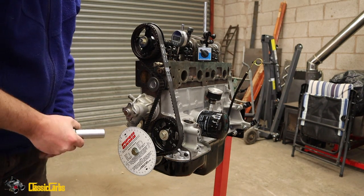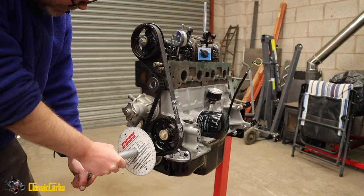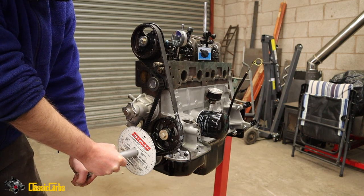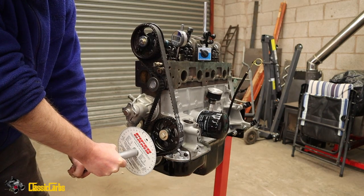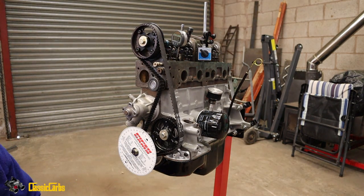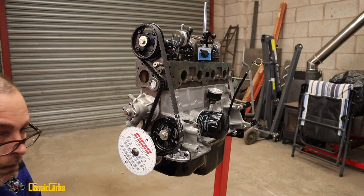Near enough. So let's take the valve up for the lift. Okay. So that's TDC gone. Eleven fifty-two. 1153, 1154, that's full lift. Problem is, that's not very accurate. No, it's not bad at all, actually. So now we're opening at 85, 86, 87. Now we're too early. Ugh, bollocks tight.